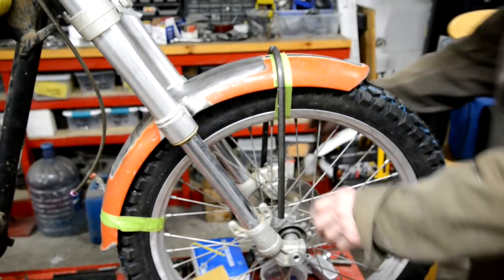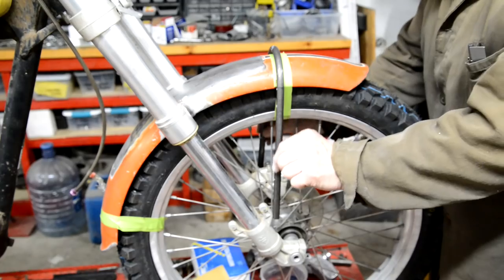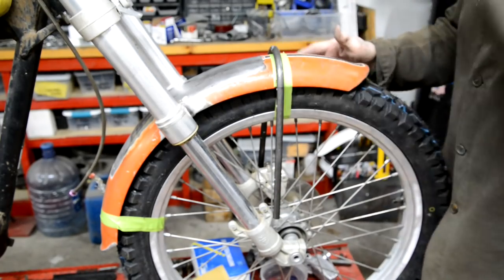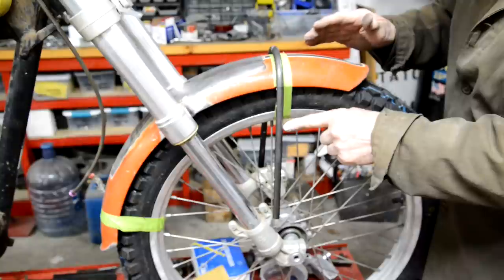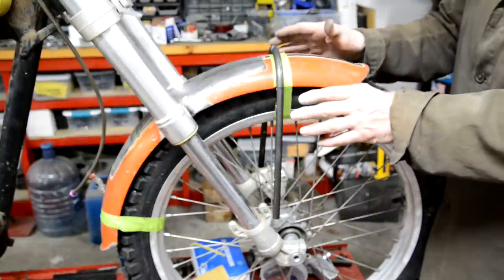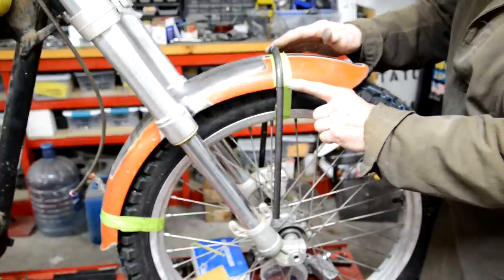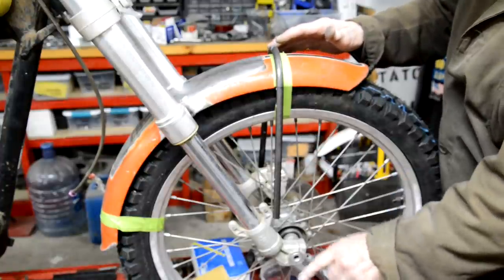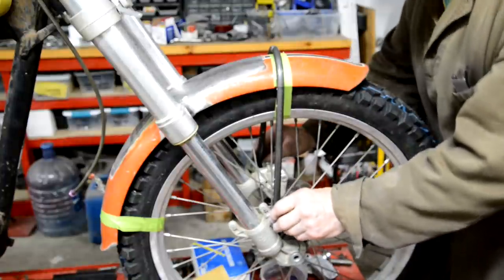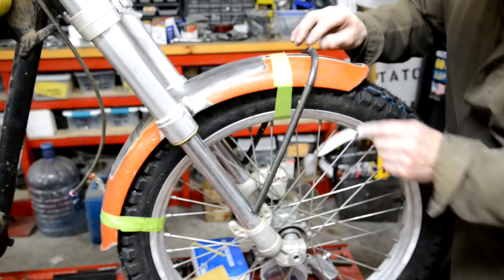All right. Bending it down here, it looked awful. So I more or less straightened them out. I couldn't find a way to put it into the tube bender to bend it here. So this stuff, it's 4130, it's reasonably springy. It doesn't deform that easily. So what I did was I put it in the vise, and with a long tube on, I just bent it up at the top here. Just kept doing it a little bit at a time. And I think that that is about it.